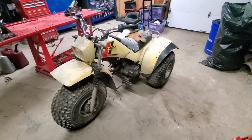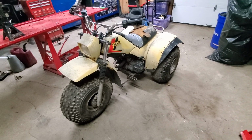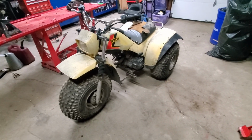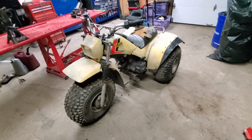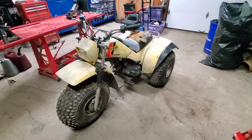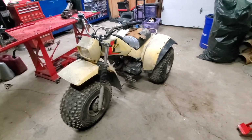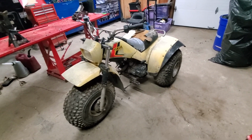Okay, so just a quick recap on this week's video. We worked on the Yamaha 200E. This was the machine that was the very first one on the trailer. We went through, changed the rear diff fluid, adjusted the rear brake, patched the rear tire that had a slice in it, so we could take it on a nice, easy test ride to find out what other flaws the machine had.